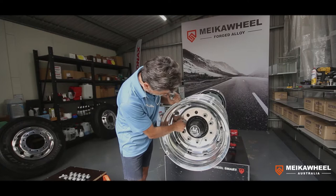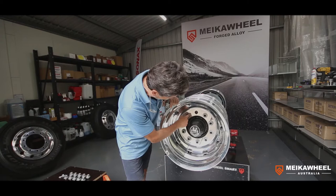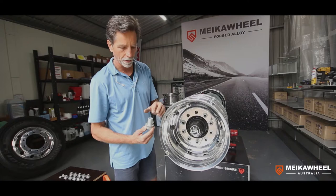In order to overcome this problem we have a specific set of wheels with a bigger bolt hole diameter — 32.5mm — and we operate with a sleeve nut. The sleeve nut has a deep thread going right through and will engage all the way through.